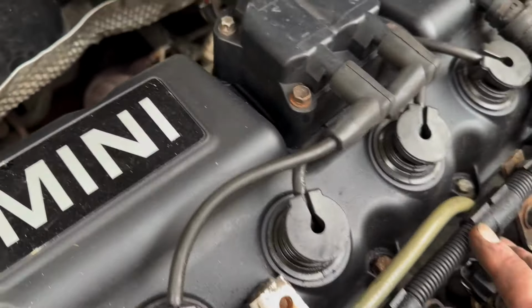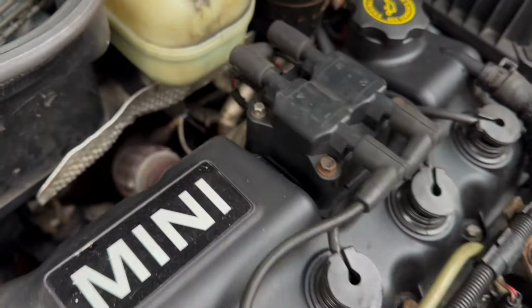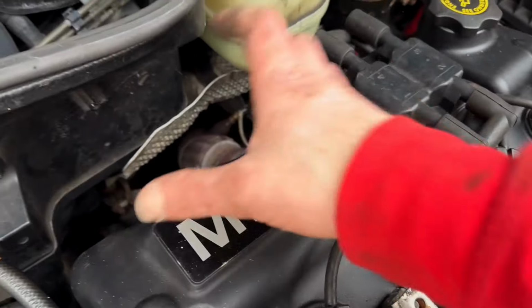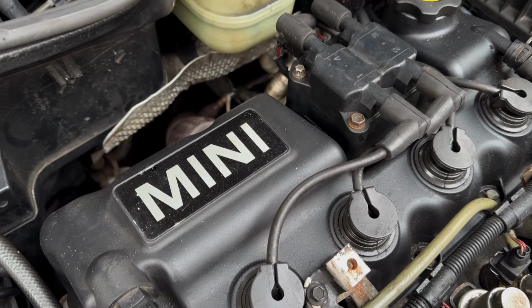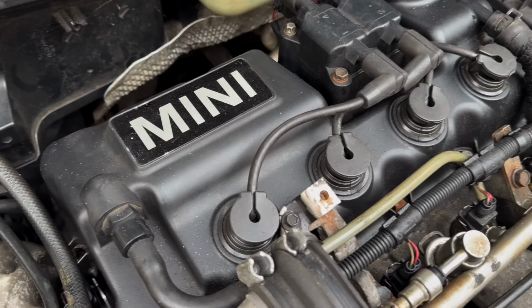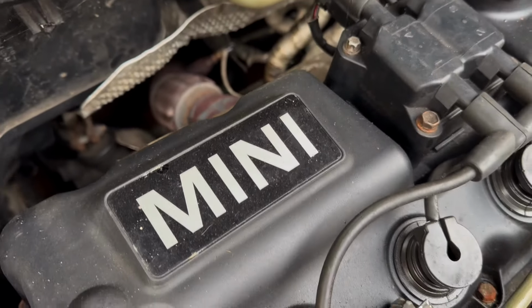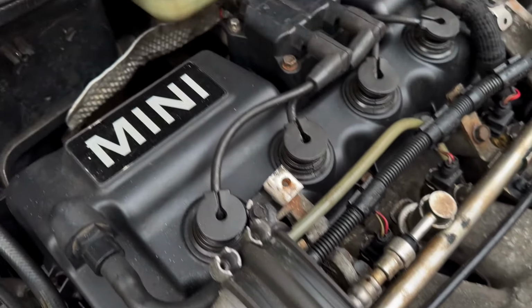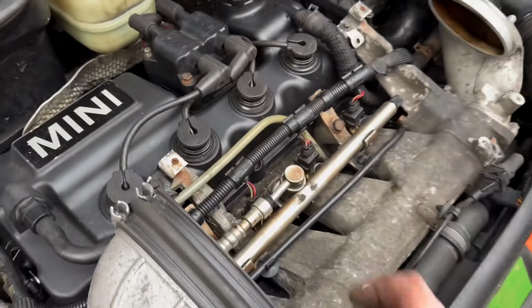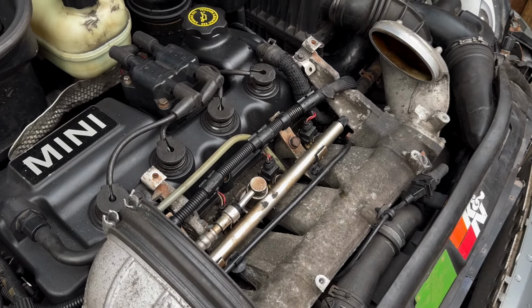So I'm just leaving the cooler off for a minute, so I can then take the core pack off, move the expansion bottle things, so then I can get the exhaust off out through the engine bay, which is how I seem to remember I'd done it before, or I took it out the bottom before, but put it back in through the top, and going through the top was a lot easier than going through the bottom. So I'm just gonna do that, and then we'll finish putting it all back together and give it a start to make sure we've got no leaks.